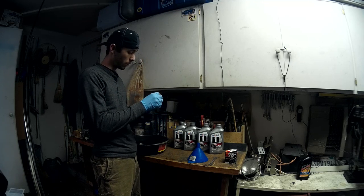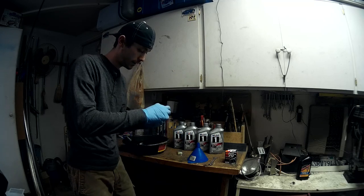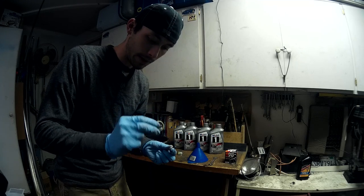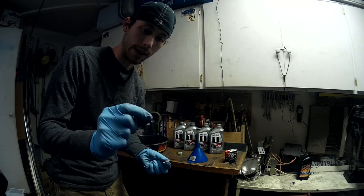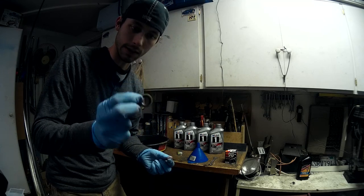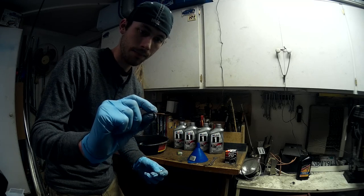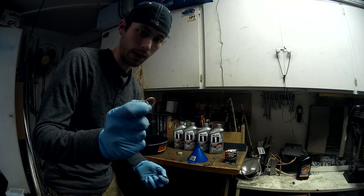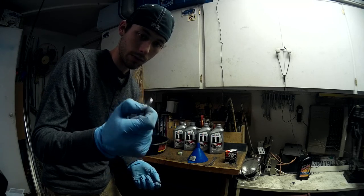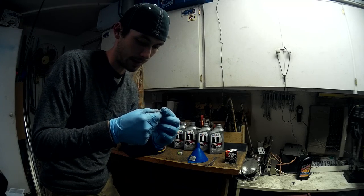Crush washers — there's a whole lot of different kinds here. There's nylon — this is a nylon washer. And then this is a combination rubber grommet around an actual steel or aluminum washer. It's actually a rubber plastic grommet. And this is a copper one, which actually compresses quite a lot when you seat them. This is just an aluminum crush washer. And this is just a plastic, probably nylon type one again.